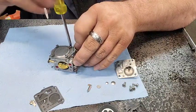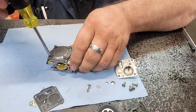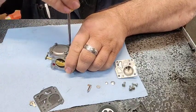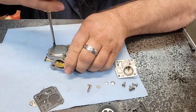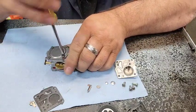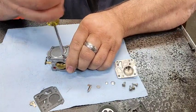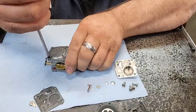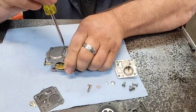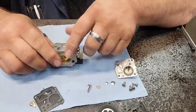After you do it a while, you get kind of used to it. So that's why we make these videos. If you can't get it to tune on the bottom — if you rev it up and then it sits there for a minute and starts getting richer and richer and dies out, and you run your low screw in all the way and you have no throttle response — then you've probably got a leaking plug or a leaking needle, and it's getting fuel on the low side where it's not supposed to be. If you have a lean condition when you rev it up, that's usually the needle's too low or the screen's stopped up.